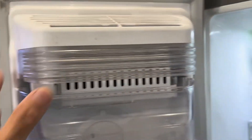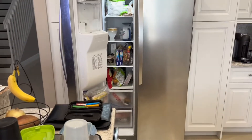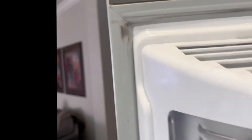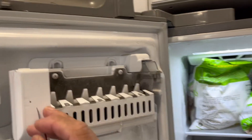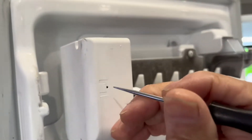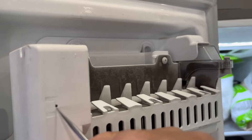The third reason — I'll be showing you how to put the ice maker into harvest mode. Remove the ice maker bin, then remove the cover on the top and the ice maker. In this particular LG ice maker, the secret button right here puts it into harvest mode. You get a little pin and poke it, holding it for five seconds until you see the fingers start to turn.